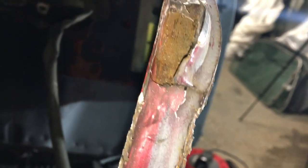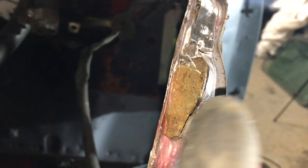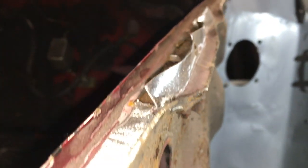Now, although some people may see my methods as putting paint between all these surfaces a bit much, if you just put some zinc primer between this and your wing and your inner wing, you're not gonna have this issue again. And I don't get why people don't do it. So I'm gonna continue to get this off, and that'll be one job done.